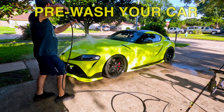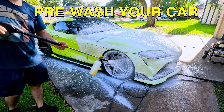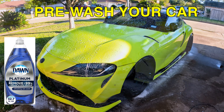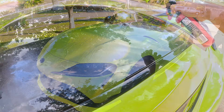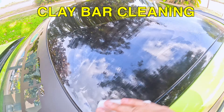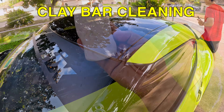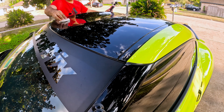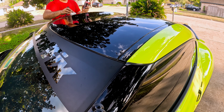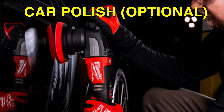The first step is to wash your car — rinse and wash it with soap. Use a dish soap to remove any wax from the paint. The next step is to use a clay bar to clean any dirt or grime stuck to the paint, because you don't want to put a ceramic coating on top of dirty paint. Clean the whole car really well with a clay bar.